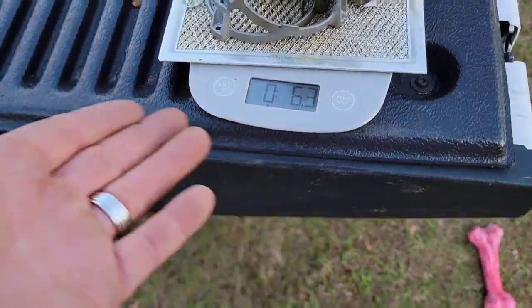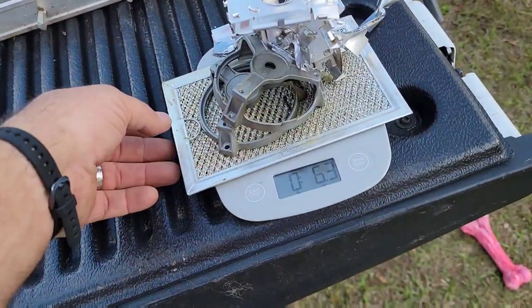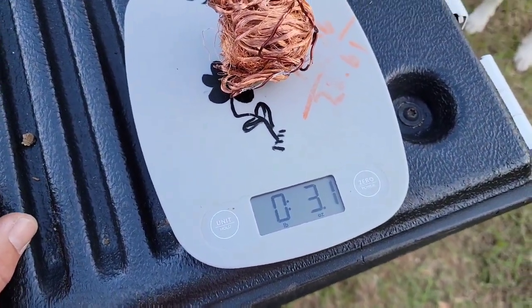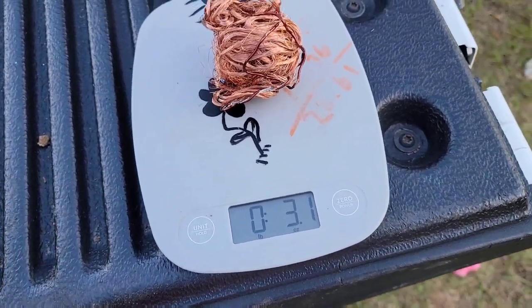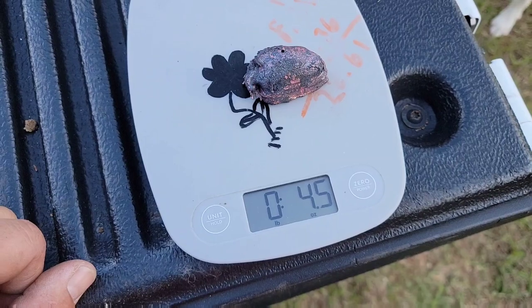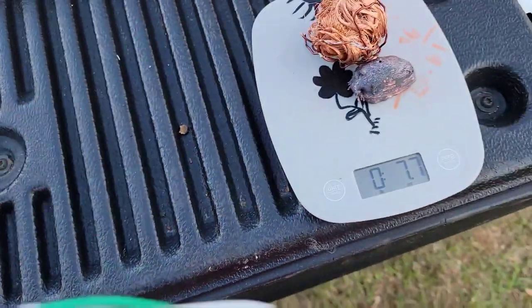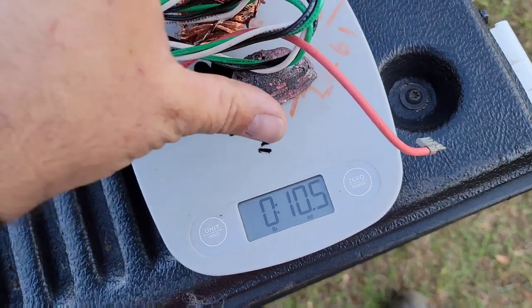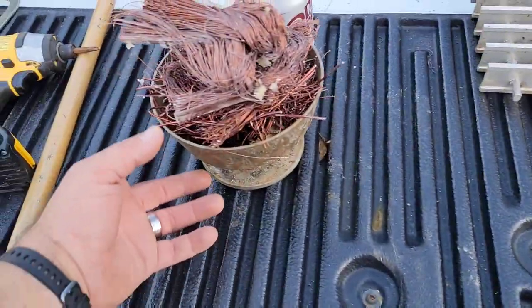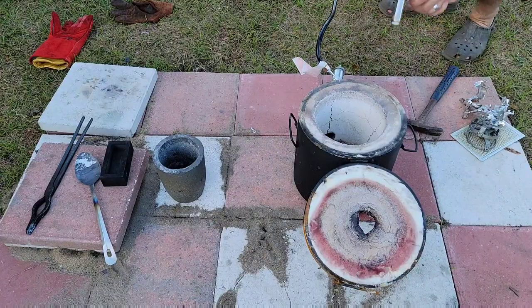You can see there's six ounces of aluminum in that microwave — not worth pouring by itself, so we'll add to it and weigh it up when we're done. For copper, we got three ounces of pure copper, which as you can see is not really worth melting down on its own. So if we melt that together and strip a little bit of wire and add it in, we should get closer to half a pound, which makes it worth burning. Let's go ahead and clean out our crucible — we don't want to contaminate our metals with residual metal from previous pours.